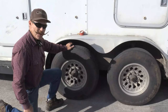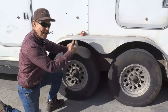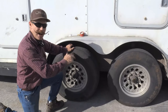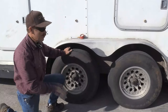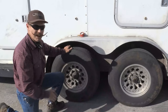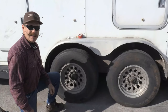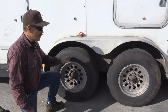What you're looking for is when you stop — say you picked up a nail in a tire and it starts getting a little bit low and you don't realize it. A little while down the road it gets too hot and then it comes apart. So if you just stop and check, it might be that the last time you got fuel it was already getting a little bit low, but you never touched it. What I do is go around and touch them — that way you can prevent some trouble and often figure it out before it happens.